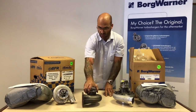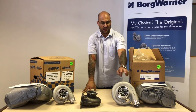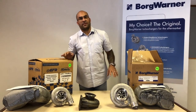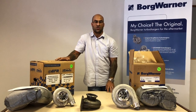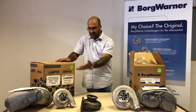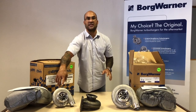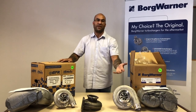Specifically for our market. You get two versions of the S300: this is the 825 horsepower version, and you also get the 1100 horsepower version with an 80mm turbine wheel. The S200SXE is 650 horsepower capable. So if you've been using a T3, T4 or a Chinese knockoff GT35 and want a genuine, reliable, proven product with burst containment housings and better boost response, linear response, and overall power — the S200SXE is a great option. For bigger builds, go for the 825 or 1100 horsepower S300SXE.